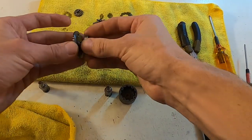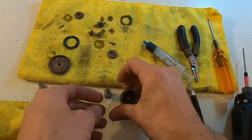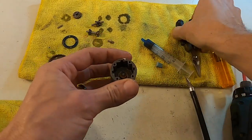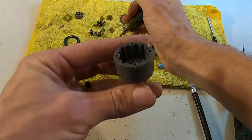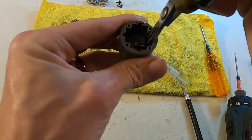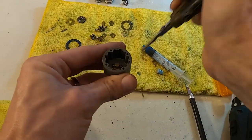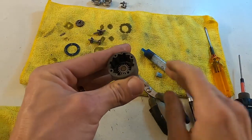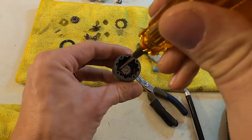Now both ends are ready to build. Put my 8x16s in and slide it in. Just make sure all the action is really smooth. Sometimes you'll see the O-ring pop up a little bit — just take the pliers and push it down. Drop in the pin, center the pin, and then wipe off any excess grease on top. Take the sun gear, drop it in. Then I like to start filling it with oil now so I make sure to get oil really good down around the outside.